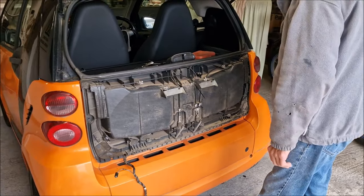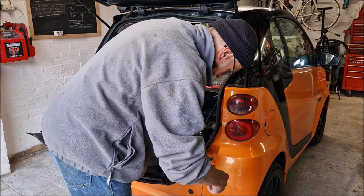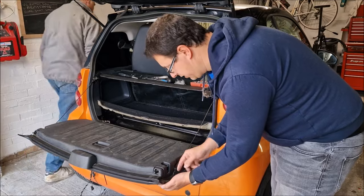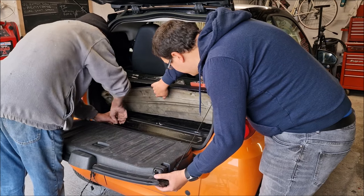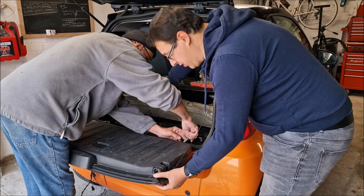You can use a pick or a lever to get it out of there. It's handy it's got them little white marks to show you where some of them go. When you've finished taking all them clips out you need to remove it from this little notch here which goes into the rear of the car - that is the whole reason we've had to take all that off. So now that wiring loom hangs free and it's not connected to the tailgate, we can take the tailgate off. It's now two nuts and two Torx bolts that hold the side straps in.